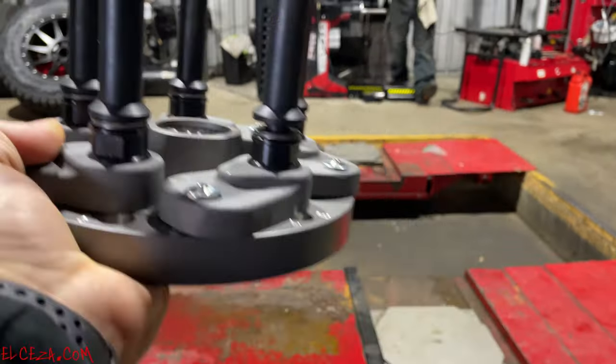How many of you have balanced a tire, didn't take the weights off intentionally just to see if it would balance out? Okay, guys, everybody's done that? How often does it work? One in a thousand. But the problem is we forget that we left them on there and we start adding weight. It's chasing weights. No, it's not chasing weights. You left the weights on it to start with, and then it added more weight, and then it added more weight because it's seeing weights all over the place.